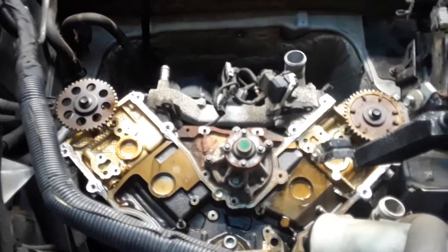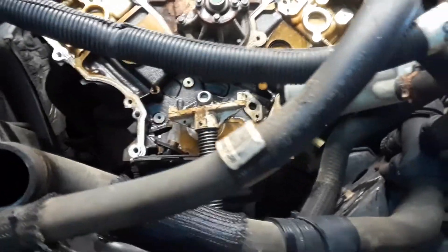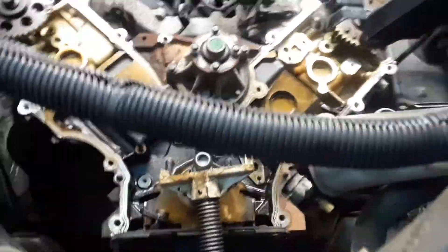So we're going to change it now. So you have to go through all that work? Yes. So why are you taking the oil pan down? We want to check the metal that went inside the pan, so we want to clean it up. We don't want the metal going to damage the engine.